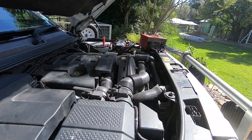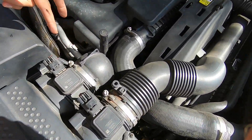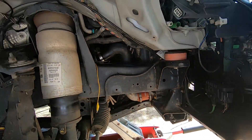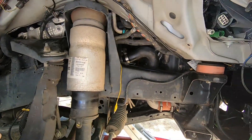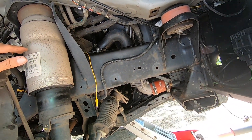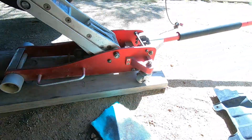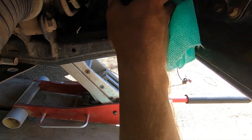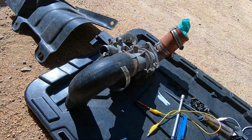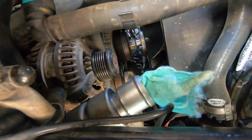I looked at going through here but this pipe looks like it runs a long way back. I've just pulled this wheel liner out and this little panel here should make it a lot easier to get to. I'm going to pull this air valve out. It came out with a bit of oil and made a bit of a mess — I plugged everything with rags so I don't get any dirt in there. It's got a broken clamp, so that's one bonus I found. I got in here and pulled the belt off — tension is right there which is handy.